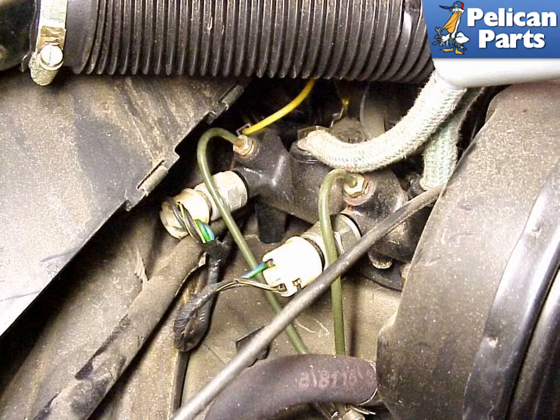This photo affords us a great look at the master cylinder in the power-assisted 911s. The two main brake lines are the metal ones exiting diagonally out of the master cylinder. The fluid is fed from the reservoir to the top of the master cylinder via the cloth braided rubber hose. The two electrical switches that exit out the side of the master cylinder are used to detect pressure drops in the system.